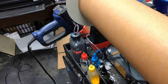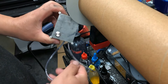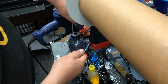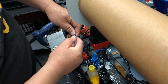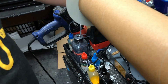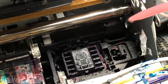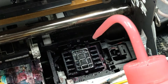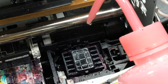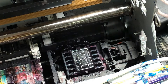With the print head protected, we move to the capping station. We're going to suck from the waste line using this little thing called a TMS. Very simple — you push that button, suck from the shorter end, and it dumps the ink out from the longer end. Connect the waste line to the shorter end and put the longer one into the waste ink bottle. I'll put the link above and in the description. If you don't have this machine, you can have somebody hold a big syringe and suck from here. With the TMS sucking, I squirt water and use my finger to massage the rubber seal around it to make sure there's no cracking and no ink deposit, because you need that seal to be airtight for effective print head cleaning.